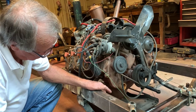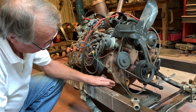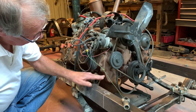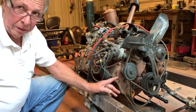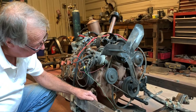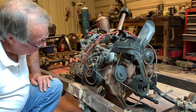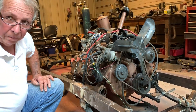I learned that when I was 14 or 15 years old — I took a Mercury and put it in a '44. A '53 Mercury has the same kind of water pumps as this, but a 49-50-51 has the tabs that come out. I put a motor like this in a '40 Ford, and I had to order water pumps. And this was in about '64, and they were almost impossible to get.